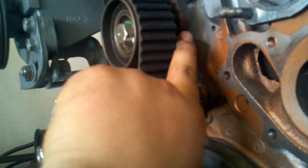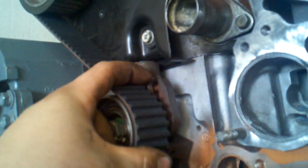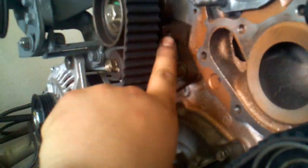You need to slowly, and I mean slowly, insert a bolt in there until it hits the back of this arm here. This little arm pushes the piston on the hydraulic tensioner. Put the bolt in until it touches that, then slowly turn it, just maybe a quarter of a turn. Do not get anxious. If you turn this bolt in too much, you'll crack this hydraulic cylinder and have to go get a new hydraulic actuator, and those are like $100. Or you can just replace it if you want.